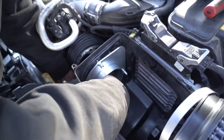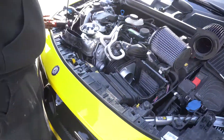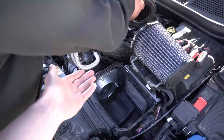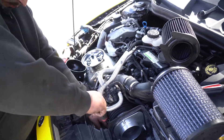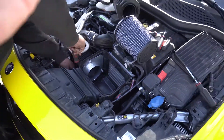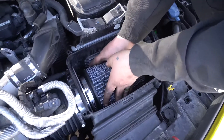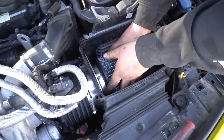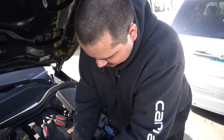Try and jiggle the screws because it's going to be difficult to get to. Definitely, they did not make it easy — German engineering, man. Now we just got to reinstall the equipment, putting the turbo inlet back onto the adapter, putting all of the hoses back on, as well as tightening up the clamps, throwing in the filter, and it's as simple as that. Now you just put it in there, tighten up the clamps, and let's see what she sounds like.